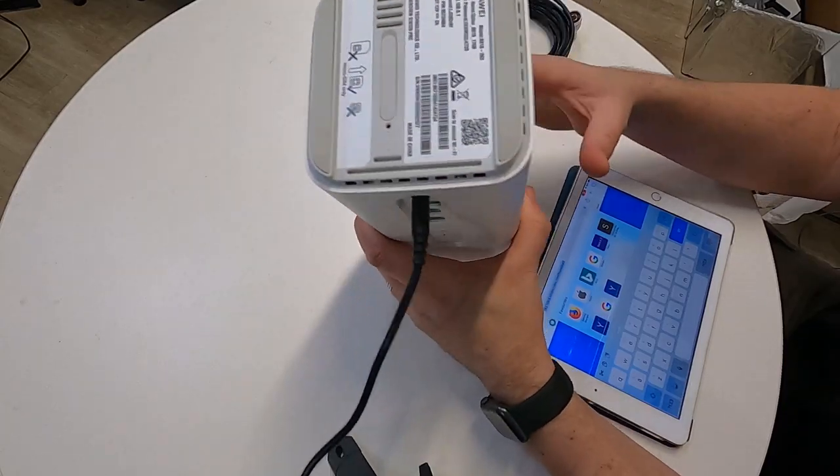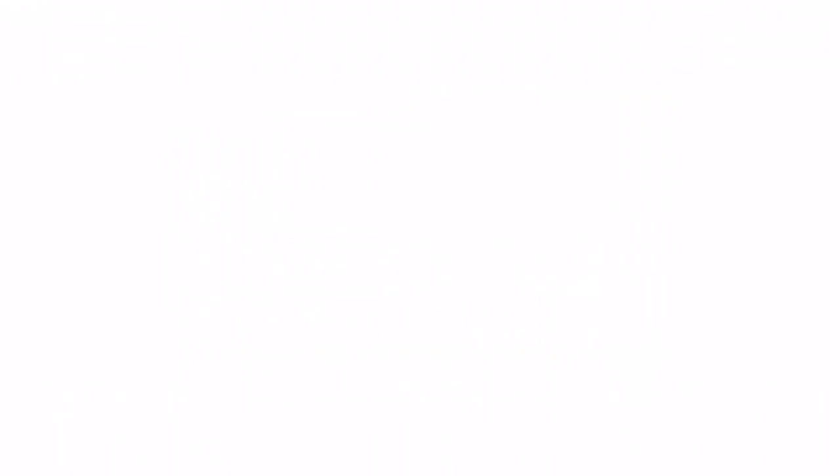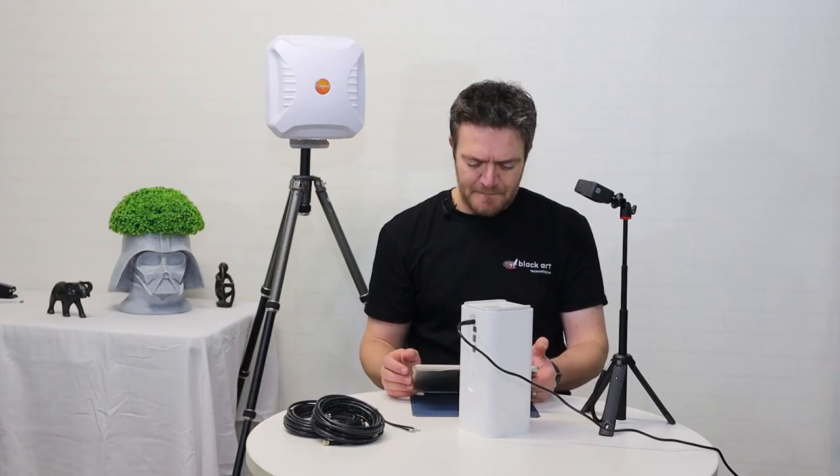What's most important is actually the bottom of the unit. As with many modern electronic devices, you'll get all the login information and initial password setup stuff you need to know. I've already set it up so the password and SSID are specific to what I want. You have to remember to change the password as soon as you can, because these default numbers are easily hackable. So first thing you do: power it up. Second thing: change your passwords. What still remains visible is the IP address 192.168.8.1. I'll type that in to get to the landing page for the device.